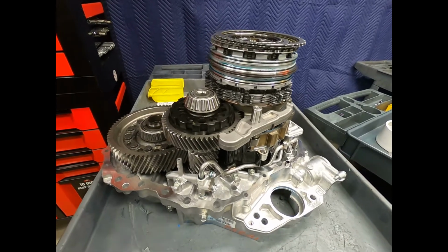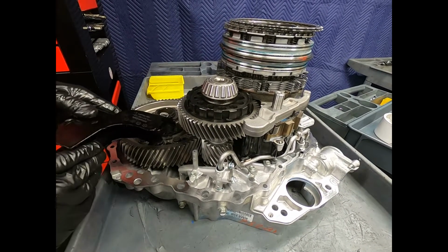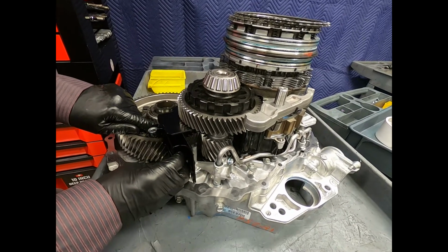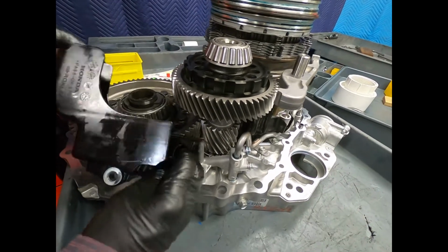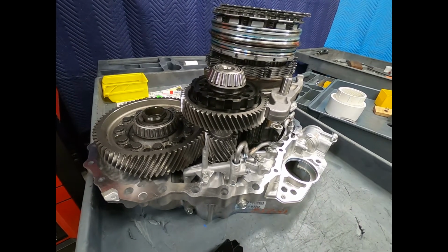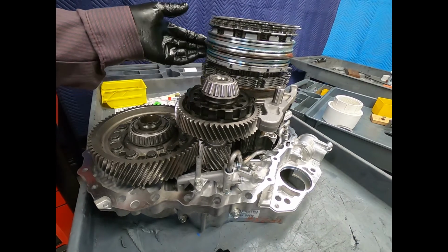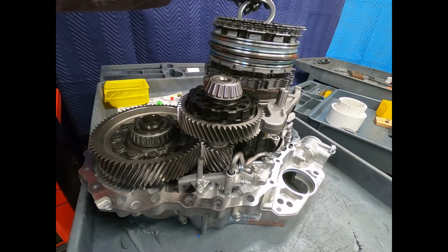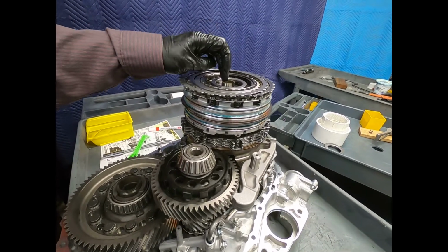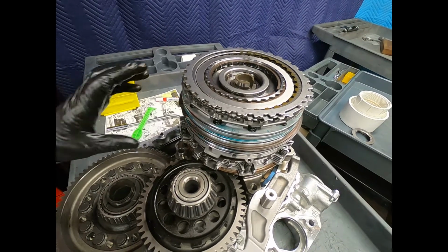One thing that we had talked about was this oil weir, and what this is going to effectively do is direct lubricating oil to this carrier bearing. I'll slip right over here, obviously. There we see it, the 10AT automatic transmission. Now, quite a bit more involved, obviously, going through the clutches and rebuilding them. You can see these 2 brakes, kind of self-explanatory if you had to disassemble them. Here we see the rear Torrington bearing. And we saw, of course, the distribution tubes going to the corresponding bushings down inside the input shaft, there to apply to the spinning clutches.